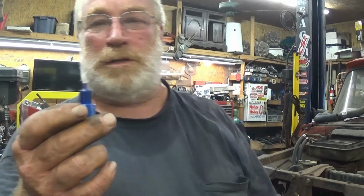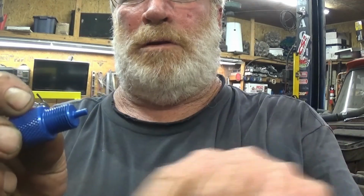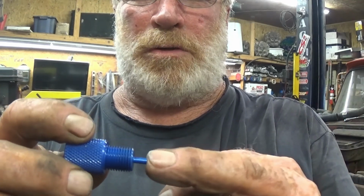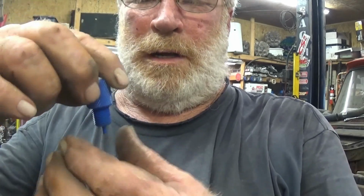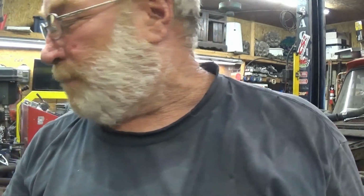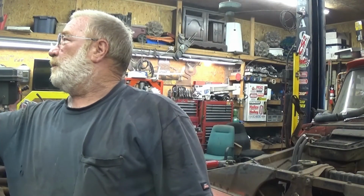But you take that switch out, and it has that little nipple. You center the valve back up, and you can see it with a flashlight. Look down in there and take a little bitty jeweler screwdriver or something like that, slide it back in center, screw this down, and then this screws down and sets in that saddle and won't let it slide, so then you can bleed brakes. Great, that works. Took 2 weeks to get it, but it worked.